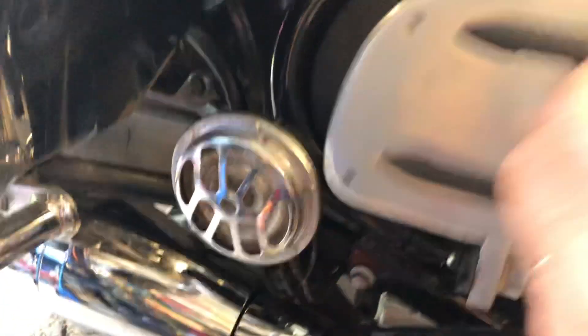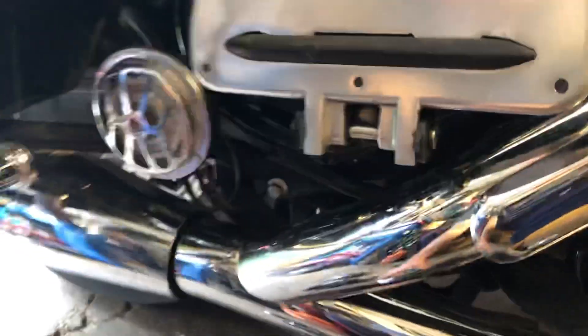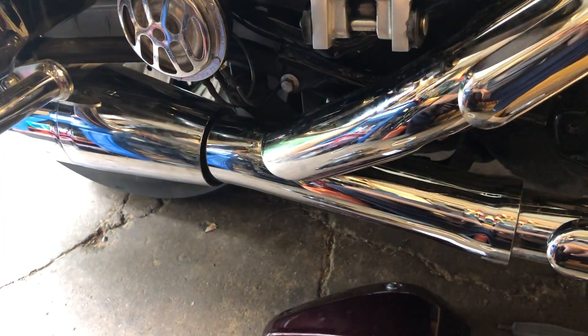I mounted them to the rear bolts. Here's how they come — they come with a bracket, mounted on the machine and out of the way. It wasn't too tough a job. I used number 12 wire and crimped female spade connectors that slip onto the terminals, then soldered them. I do not trust just crimping those female spade push-on connectors — you bump the wire and they just come out by themselves.